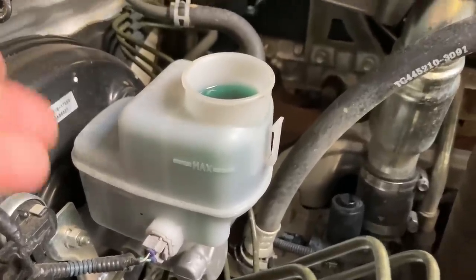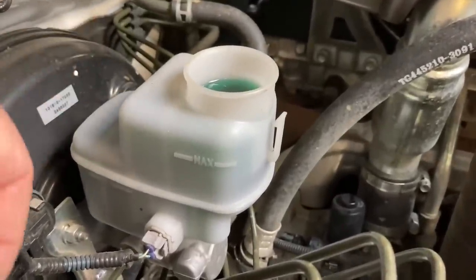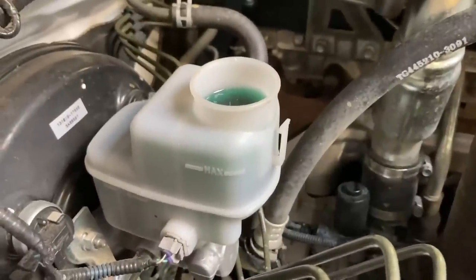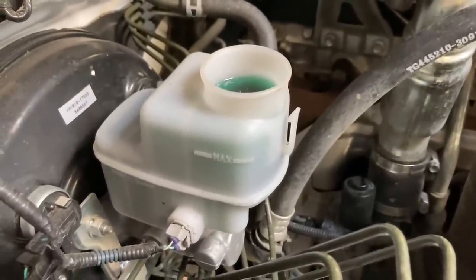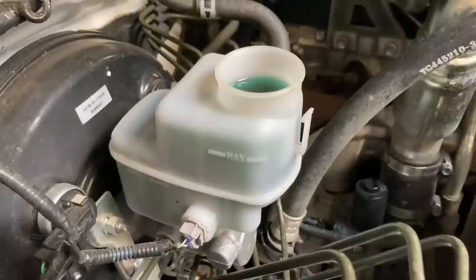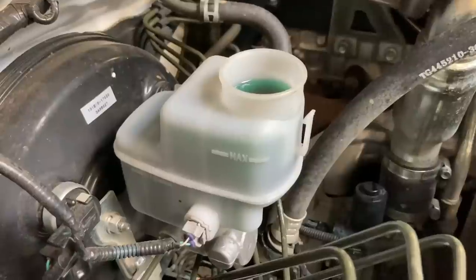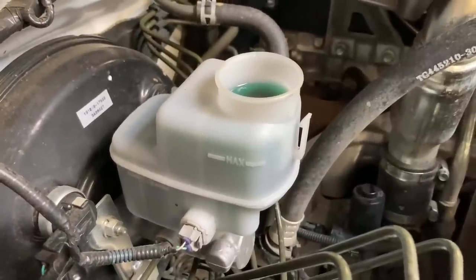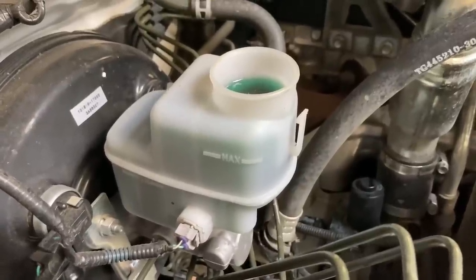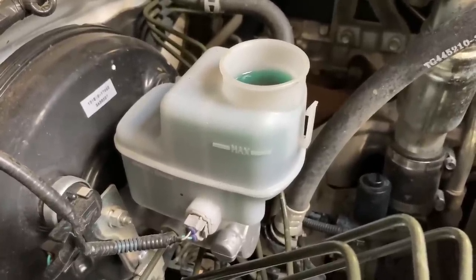Obviously air goes to the top, so if there's any air in here it comes to the top. But while we open up the bleeders and the fluid flows down fast enough, all the air comes to the top of the caliper. What we're going to do here, every two years or by Toyota's schedule it's every 40,000 kilometre service. They've somehow estimated that's every two years. A lot of vehicles say every two years — they all vary a little bit, but the general rule is every two years, every 40,000 k's. There's no such thing as doing it too much — when it's two months old, six months old, the boiling point's already dropped. So there's no such thing as doing it too much.